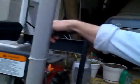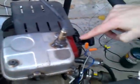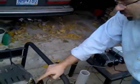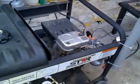On top of the engine here in the muffler, I welded on a wideband oxygen sensor so I can track and tune the engine and build my fuel tables from that. And then moving further back, we'll look at the fuel system now.